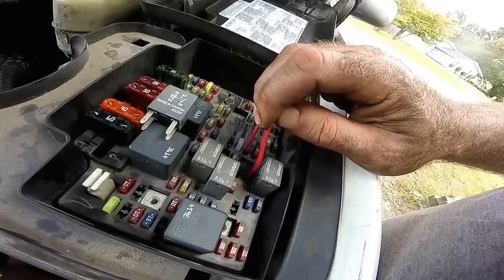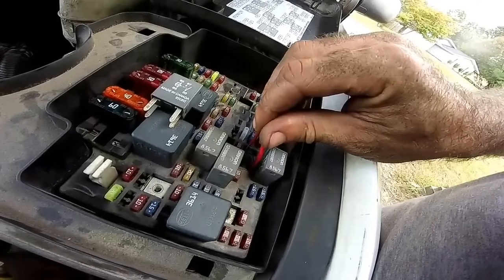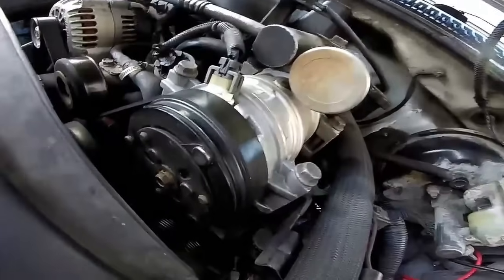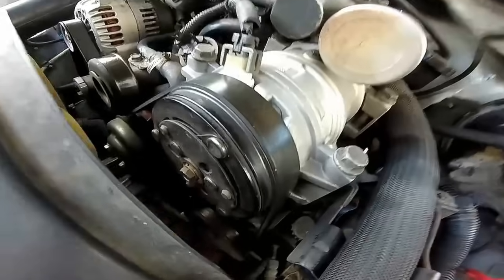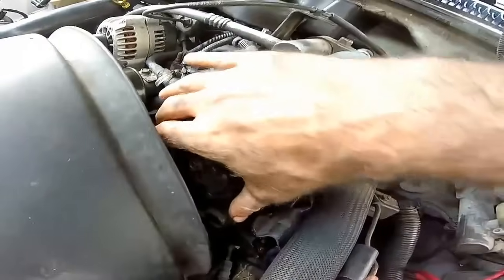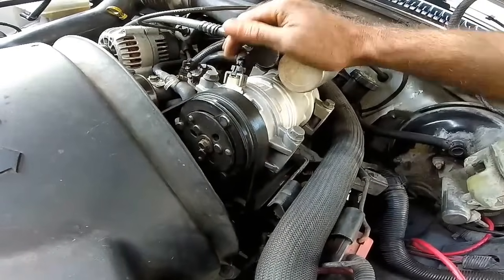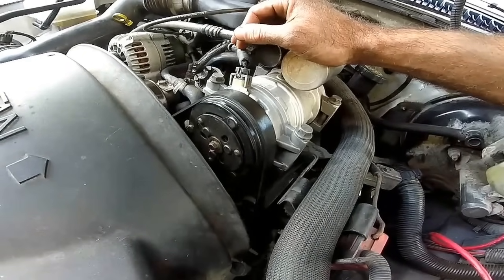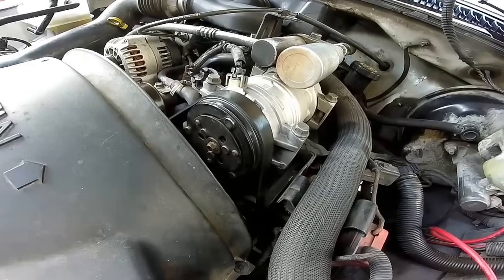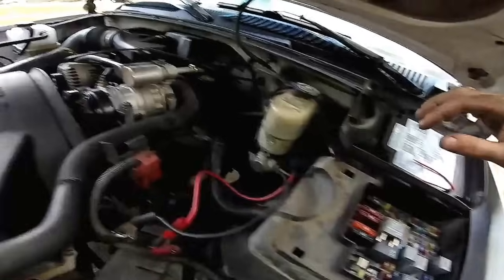Just use a piece of wire or a paper clip to do that — I usually use a power probe, but I'm trying to show how basically anybody can do it. You can hear that click. When it's engaged, you should not be able to turn this — if you can still turn it, that's an indicator that your clutch is worn out. It should stay in nice and solid like that.